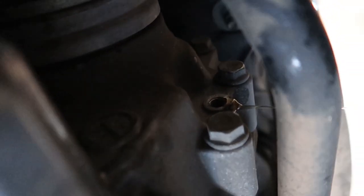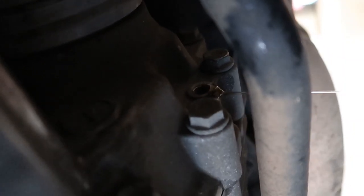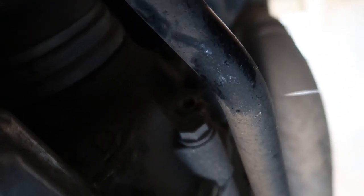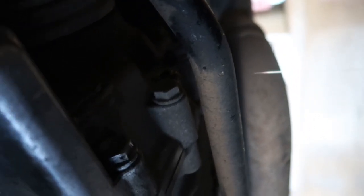The rear drain is on the back side of the sway bar. You've got the Haldex drain here, Haldex fill there, and the differential drain there, with the differential fill right up there. Really simple stuff — four millimeter Allen for drain and fill on the diff. I got an extra bottle so I can push some fluid through to get any gunk out. It didn't look too bad; it smells terrible as always, but we'll pump a bit through to get whatever's settled on the bottom out.